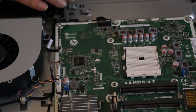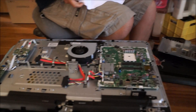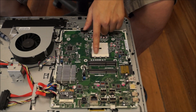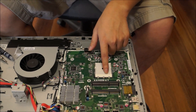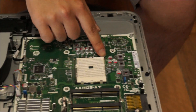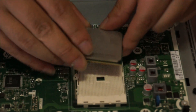With AMD CPUs, or AMD motherboards, they tell you the socket size and number on the socket itself. I'm just going to show you now — it's on top. If you open up your own one, it tells you. My one says FM2 socket. For Intel, it doesn't say that. Now we're going to align the triangle on the CPU to put it back in.